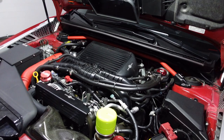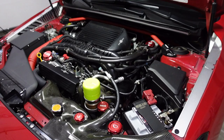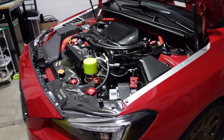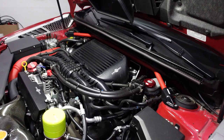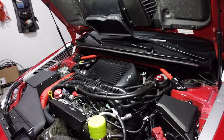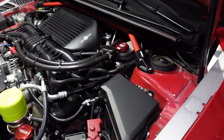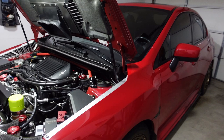I know I could have dumped more money into performance parts, but I also wanted supporting mods — what's the point of having power if your car can't handle it? There are a variety of parts buried in there that you can't see. Just under the intercooler is the Perrin pitch stop brace and pitch stop mount. The 2015–2017 WRXs and STIs are notorious for breaking that pitch stop brace next to the firewall. I did this on my 2018 just to be extra sure, even though they updated that area on the newer models.